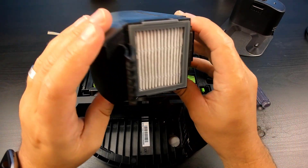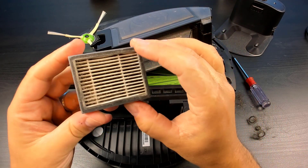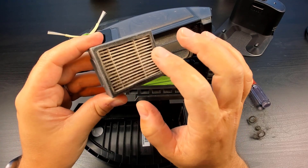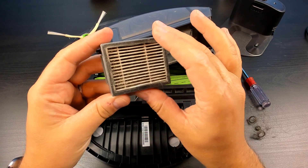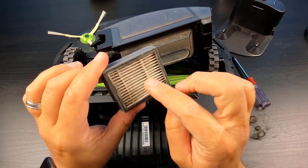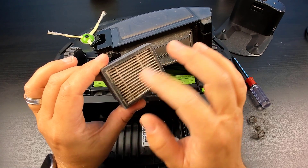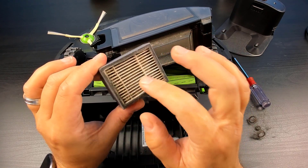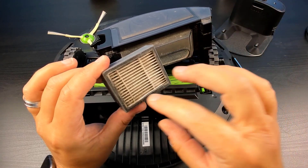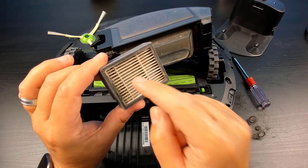Next, with the bin, first you're going to want to pull out this air filter. See how dirty this gets — I haven't had this filter in for very long and I've been cleaning it quite often. What I've found is that this is what causes the majority of those bin full errors. You can either tap this on the side of a garbage can, but what I found most effective is actually grabbing another vacuum and vacuuming this out. Once I started vacuuming this out on a weekly basis, I stopped getting those frequent full bin errors. The key is that when this is all clogged up, it restricts the airflow, so the sensors inside the Roomba think it's full when actually the air filter is dirty. So my pro tip: vacuum this out and it should get rid of a majority of your bin full error problems.